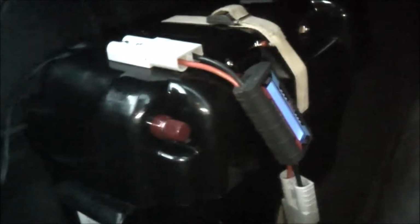But yeah, what I've done, I just hooked up going through the cigarette lighter socket, and that actually goes to my solar panel input. In this case, I've got a solar charge controller here. I've taken my cigarette lighter socket's power, and it's boosting that up and charging my auxiliary battery. There we go. You have a budget DC charge controller for your auxiliary battery.